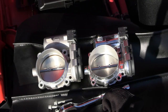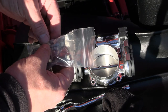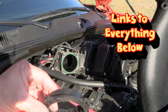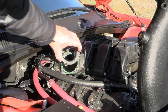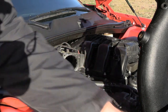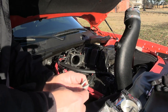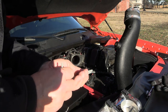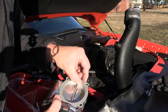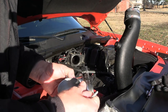These are the old bolts here. You can see you've got a size difference there because we're going to be putting that throttle body spacer on. We've got this gasket in here — we're going to take the throttle body spacer and simply press it on to the manifold, like so. Then next is going to be our gasket and then the longer screws and the throttle body. Before you put the gasket up, go ahead and put the little washers they give you onto your bolts — that's going to make it a whole lot easier. On the back side, we're going to see exactly where those bolts go.